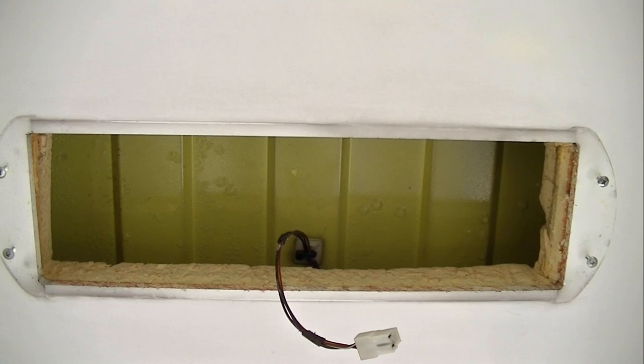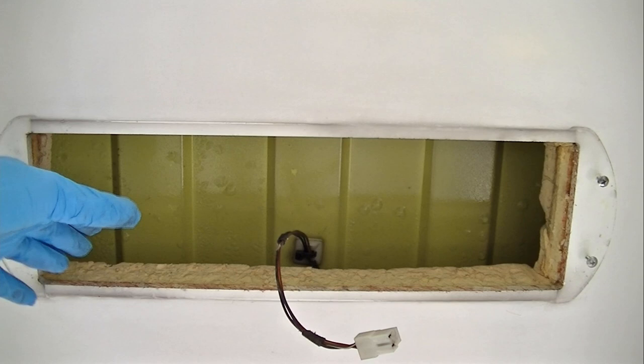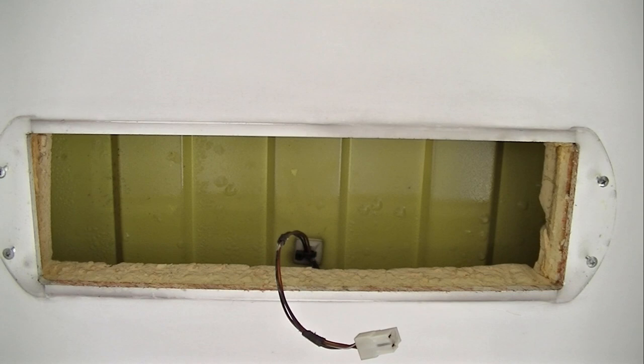If they'd put this piece of insulation — if they filled in up there as well — it would be much better. But there's a nice void out there; it's obviously an access channel. You can run cables, you can add things to it, it's ideal for what they've built it for. But as a vehicle conversion, some people live with it. A lot of people convert them as is and just put up with it and probably aren't even aware there's a problem. It's just cold and damp and they don't know why. But that's a good indication of what you don't want to be having happen.